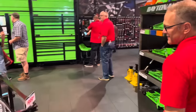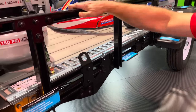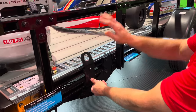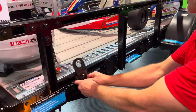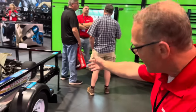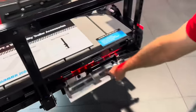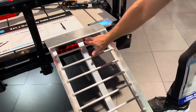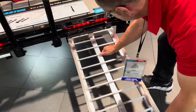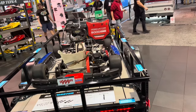The heart of this design is the rail system. There are twin rails that run all the way around the trailer. It gives the trailer complete strength so you don't need the top rail for strength to carry your payload. All these accessories bolt on and once bolted, you can slide them anywhere you want, move them to the front or back. The bolt-on rail system covers the ramps, jacks, and all items in the back. The ramps slide out and fit into a finger system. The beauty is you put the rails on, and next weekend if you want to haul sheet goods or drywall, take the bolts off, remove the rails — very configurable.